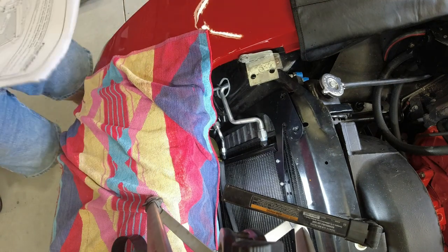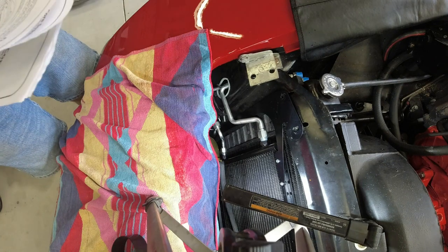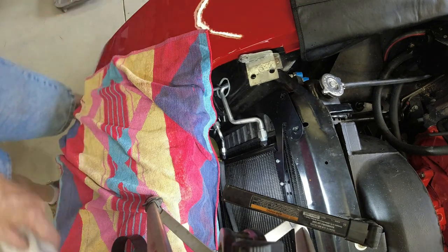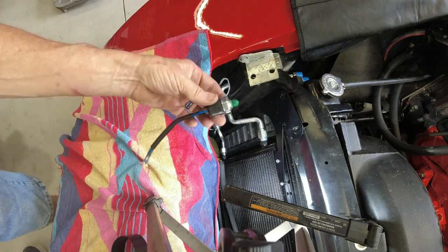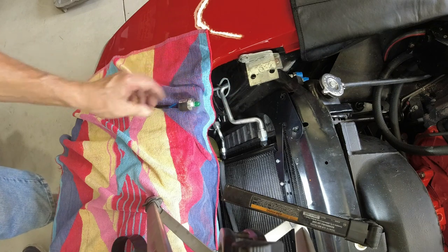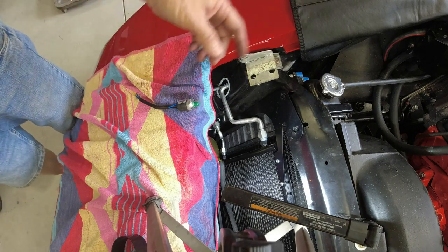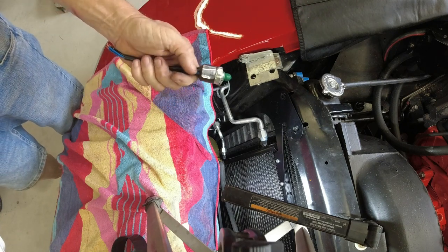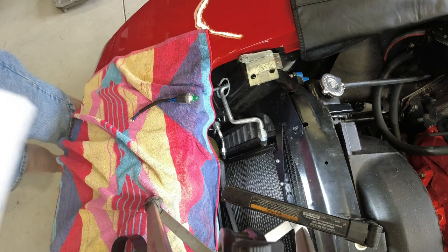And now one thing I think I screwed up on, and I should have done that before I put the dryer on, is the trinary valve. That's a trinary switch, and it actually kicks the compressor off and on. It's like a high pressure switch in case you're low on gas, it won't turn the compressor on. Plus it's got the ability to turn an electric fan off and on, which I'm not putting on mine right now,